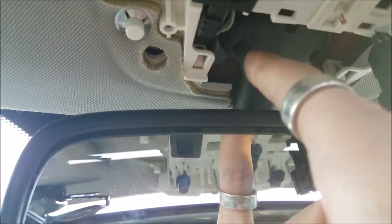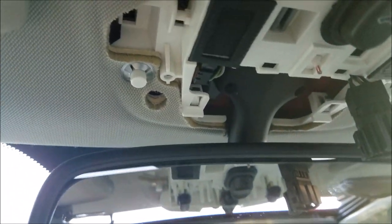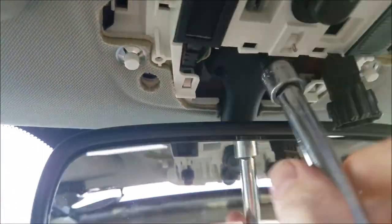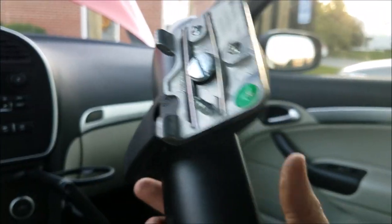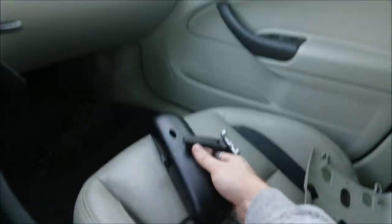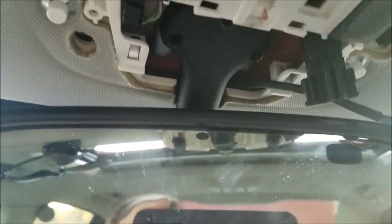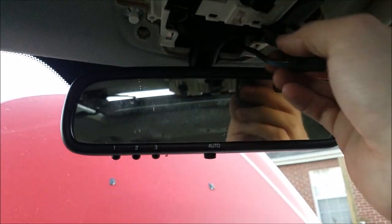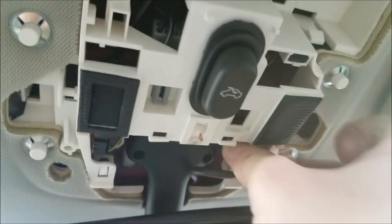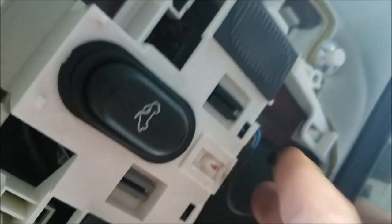Take your T27 torx bit and do these three bolts, then lower the old mirror and in reverse order install the new one. There are three T27 torx screws and they remain in the mirror - with the new one you'll get the new screws in there as well. You just undo it, it drops down, not that big of a deal. Set the new one in place, tighten it down, connect the ends, fish this up through here, and clip it back into its original spot so the wires aren't pinched.